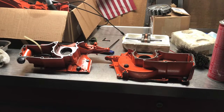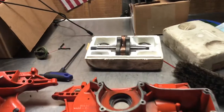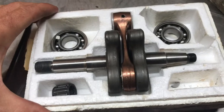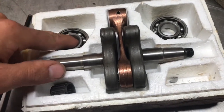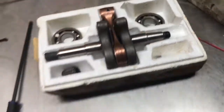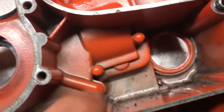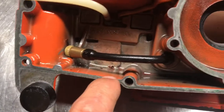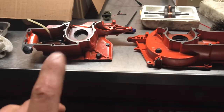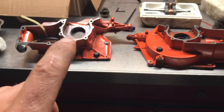Back on the 394 project. I got the cases here prepped up. I got my brand new 394 Husqvarna crankshaft and crank bearings. They've got kind of some crud in them, just because they're so old, just dirt and stuff. So I'm going to clean them up. I've got my crank halves cleaned up. I'm probably going to wipe out some junk in the oil reservoir. After I get that tightened up, I'm going to install the bearings in the cases first.